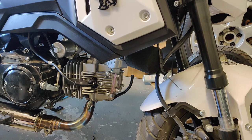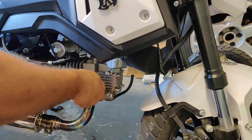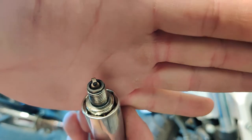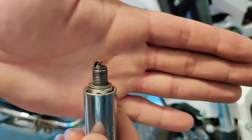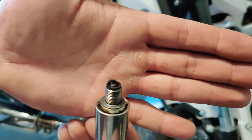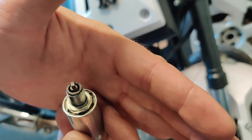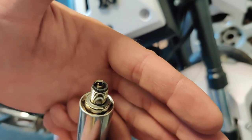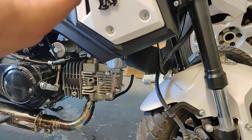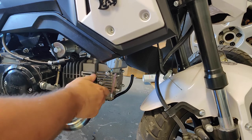I'm going to check the spark plug now and see what it looks like. That is what we're after right there — you can see that kind of golden brown look to it. It's not totally black like it's over-fueled and it's not white like it's under-fueled. That's pretty much what we're going for. Could be slightly better, but with these little cheap motors and these kind of carbs, this is about what we're going to get. The bike feels like it's making way more power, so I'm sticking with that.